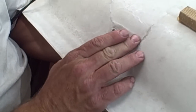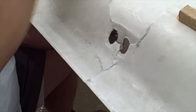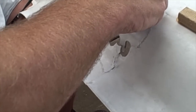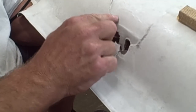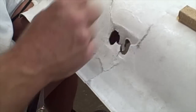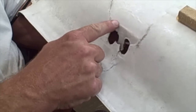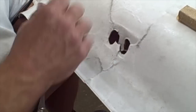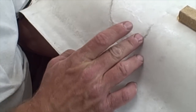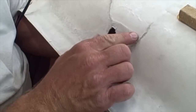That's pretty well secured there. I'm going to do the same thing on this side, just kind of hold it together. With my other hand, I'm filling the other side so I'm not getting a big intrusion on the back. It's important to do that because when you go to put the new headliner material on, you want to make sure it's not sticking out and protruding into the new headliner. We'll smooth that out and fast forward through the rest of this, then come back and show you how to do the fiberglass work.